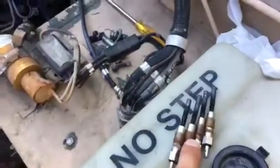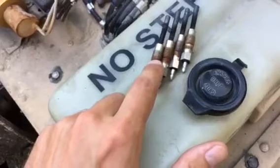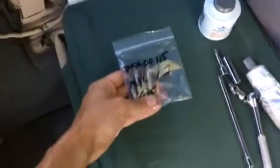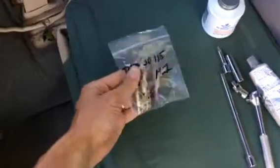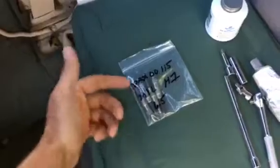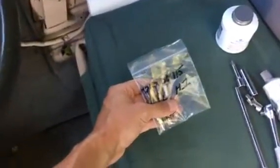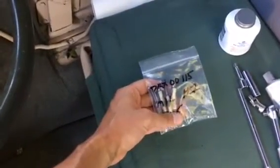The military, I doubt, did that — as there was a considerable amount of rust on these threads, and various times it proved to be a little difficult to remove. The glow plugs I ended up choosing to use were Wellman — got them off eBay. They got a lot of good reviews, supposed to be made in the USA, heat up a lot better, and resistant to swelling, which I did notice on a couple of the ones I removed.